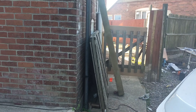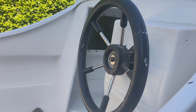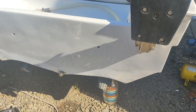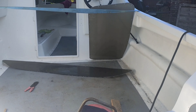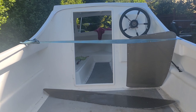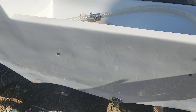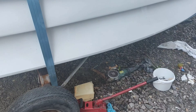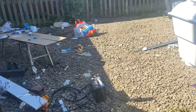For anyone who doesn't know how to do this — make sure your window lines up, make sure you've drilled your holes, and make sure they're all the right size because it is a nightmare when it's all sticky and horrible. I went round the window with a nice decent blob of Sikaflex all the way round, including covering the holes, then squished it up gently so it wasn't completely squished and got all my holes in. Then I got Duncan to stand outside with an Allen key while I went inside and put all my dome nuts on, done them all up, went round again, everything squished out. Then I used a lollipop stick and some baby wipes and turps on the cloth. It was dark and really late, hence why it's not an amazing job now, but it's something I just have to take time to clean up.